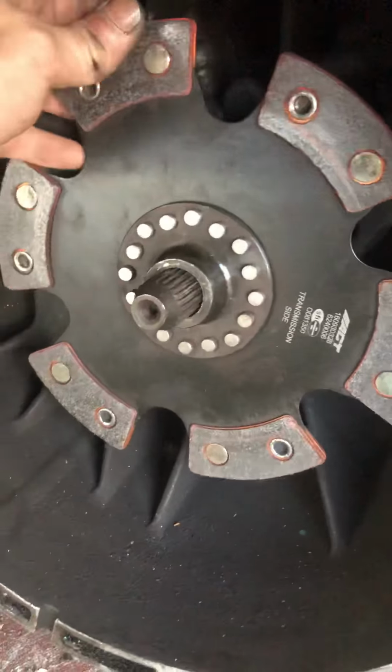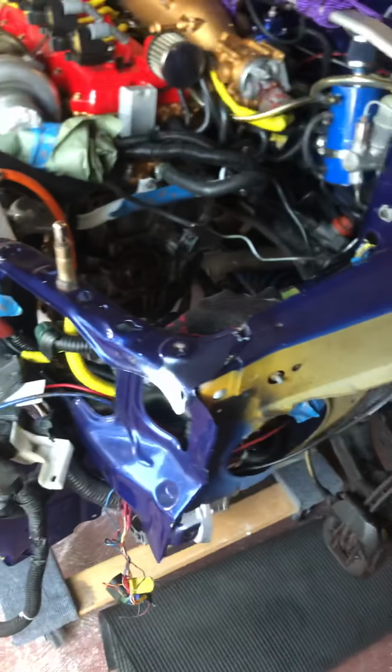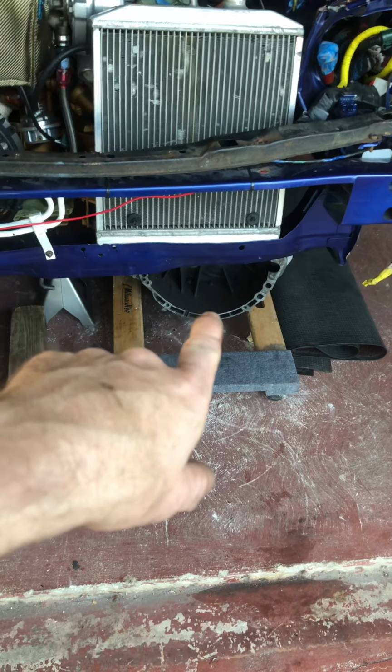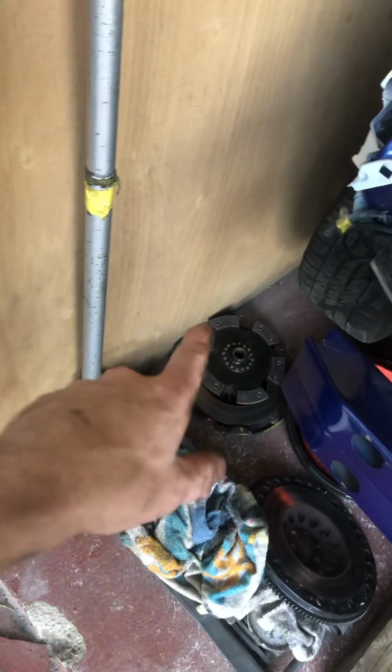So this, assembled on a car with the engine running and hearing it, the sound would have been like your transmission's gone, but it was the clutch. So if you guys ever deal with something like that, don't take it for granted and think that the clutch is shot, the transmission is shot. Chances are it's most likely the clutch, because you got to remember, between the clutch and what it's consisted of and the transmission, the gears and the bearings and everything in the transmission are a lot stronger than the clutch. You gotta remember, the clutch and the clutch disc have weak points.